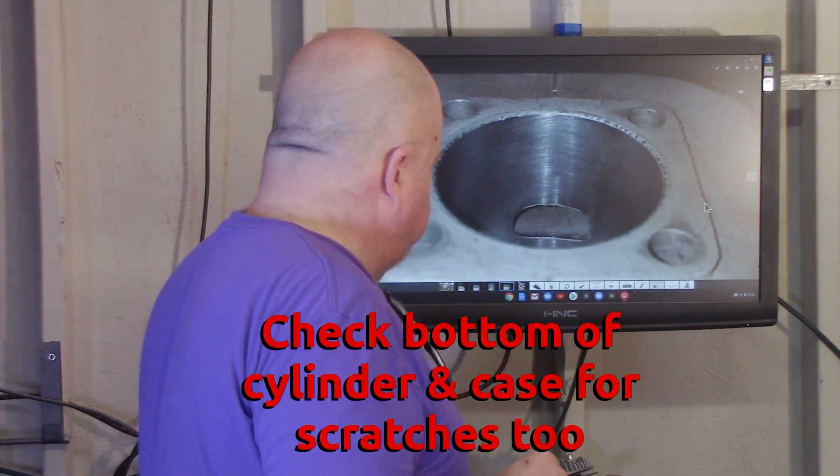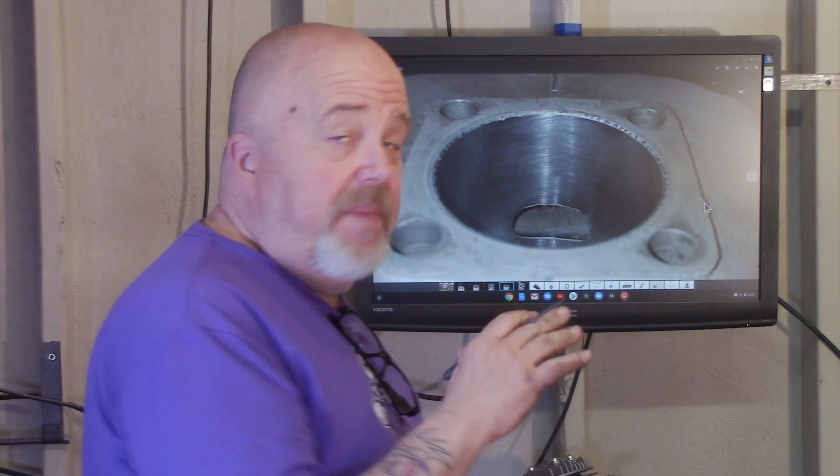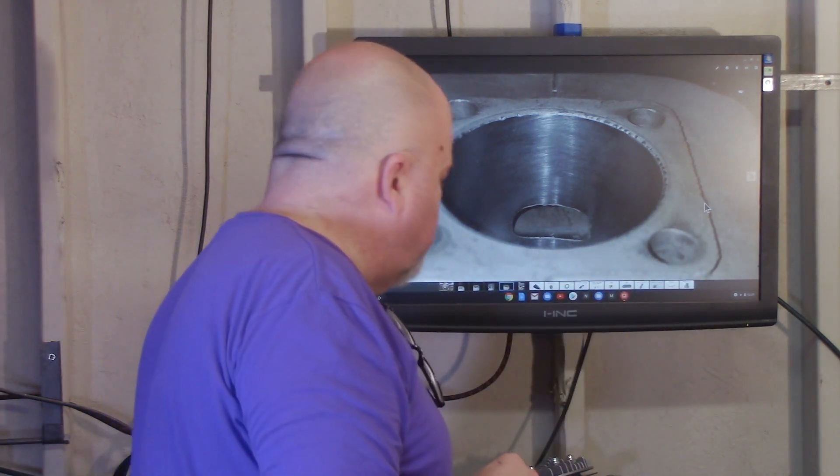On the upper deck — the top of the cylinder — you can take some sandpaper and a piece of glass, marble, or something completely flat. I'd say get 300–320 grit sandpaper, lay the cylinder head down on it, make sure it's flat, and move it in a figure-eight shape to take out any scratches. Be careful to apply even pressure — don't torque or twist it one way or another. Keep a good flat contact in that figure-eight motion and you should be good to go.